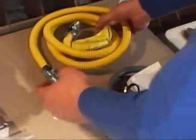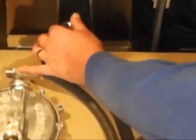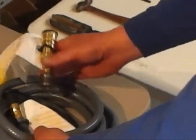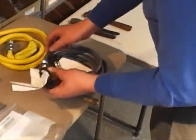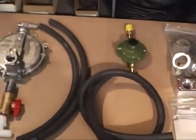We also carry a 48-inch and a 72-inch flexible line with three-quarter-inch fittings, which are not quick connects because we don't recommend that on natural gas due to the orifice size — and that's all due to the power elbow, because you will be restricting fuel there to get your fine idle on the engine. The quick-connect hose we carry is recommended only for propane because it is under pressure, whereas natural gas is more of a volume draw under BTU. You can purchase this online; it will connect into the ball valve, which we'll install into the regulator, and that way you can disconnect it and use that unit mobile.